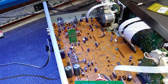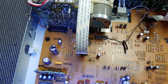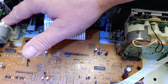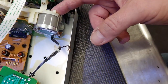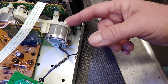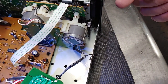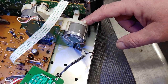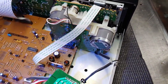Here are our tape decks exposed. I have to do some disassembling, but there's one of those sloppy belts here, and here's another. You can feel the goo on them. You kind of don't want to run those because the goo will work its way into the grooves of the drive pulley and be a pain in the ass to clean out.